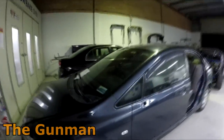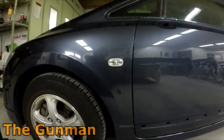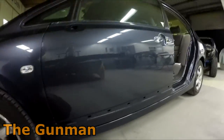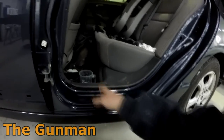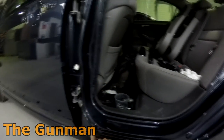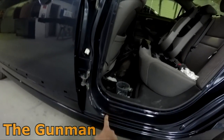This is another job I did — it's looking quite nice. There's a little bit of a color difference just through the extra coat of clear, but that's part and parcel of spray painting. I think the blend was probably between here and here, so you can even see the touch-out but it's held a nice gloss and it's quite clean. We did the quarter panel and all inside that door jamb opening. These days I find you're much better off finding that edge and going right off that edge, looping it around, rather than getting overspray and ending up with a dry funny edge when you do your blend-out in the clear.